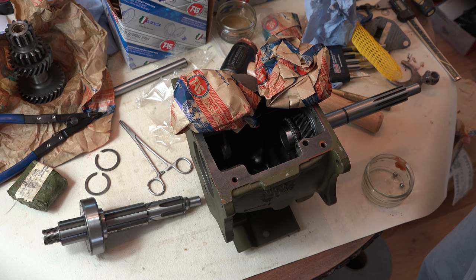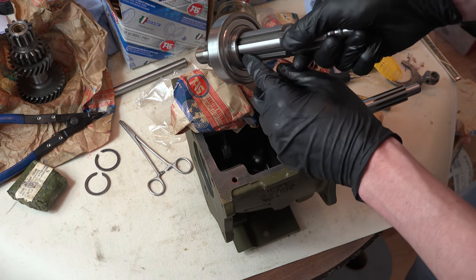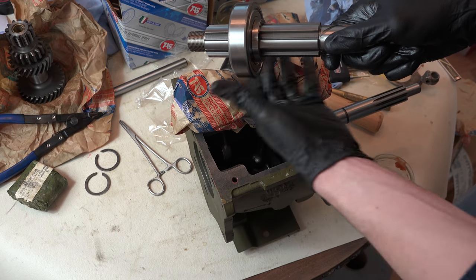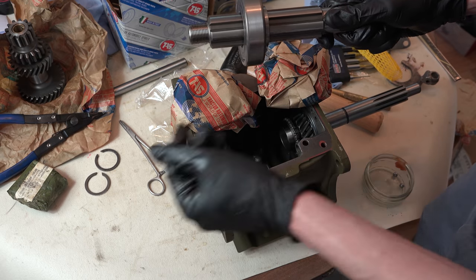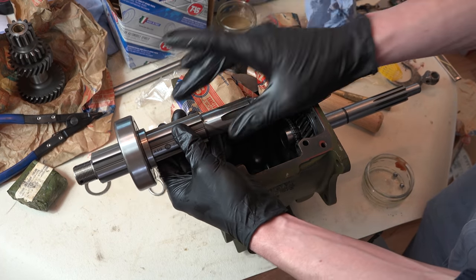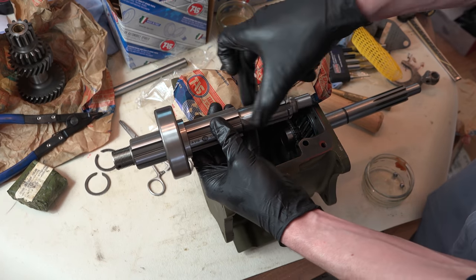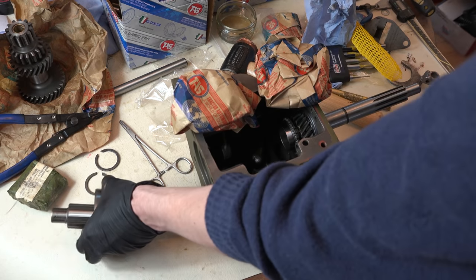That's why I don't like working on gearboxes - it's a bit of a pain getting those needle bearings in there. They're probably going to fall out anyway. This is the main shaft. We've got a retaining snap ring on there, the big fat one. Then we've got this sort of wiper which will go on a seal on the rear here to stop any oil going out the back. We'll also put in the double sealed bearings so no oil can escape out into the transfer case. So the main shaft's ready to go in. You slide it in and then put the reverse gear on, then second gear, then the synchro. You have to thread it in and do it all - it's a real faff. It's not easy to do. Let's open up some of this TAS stuff.